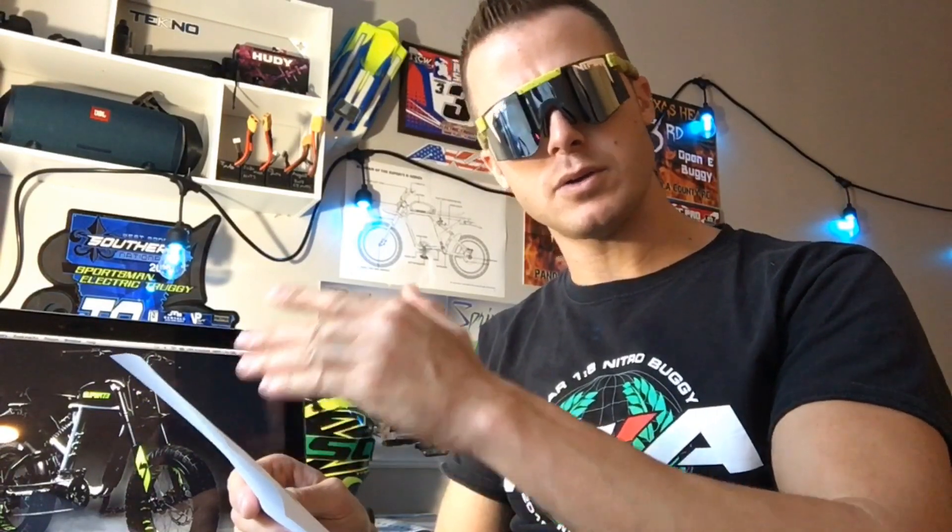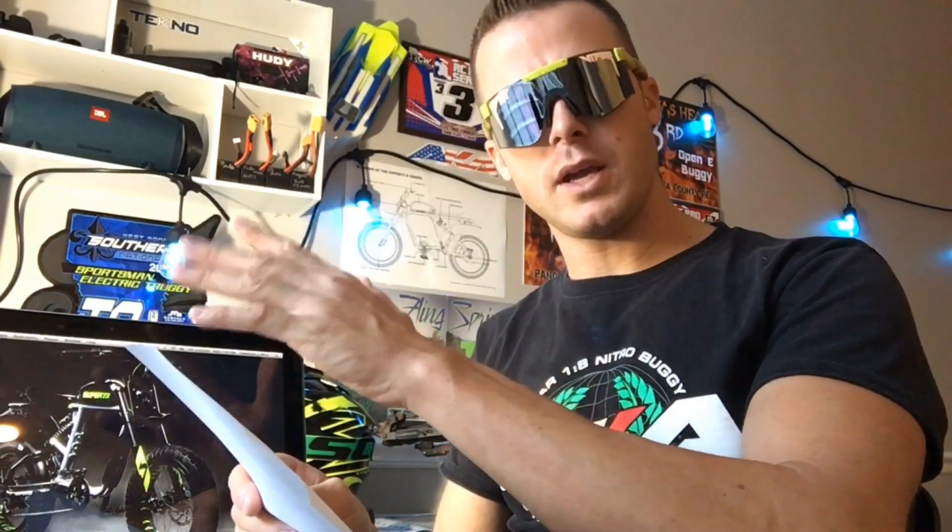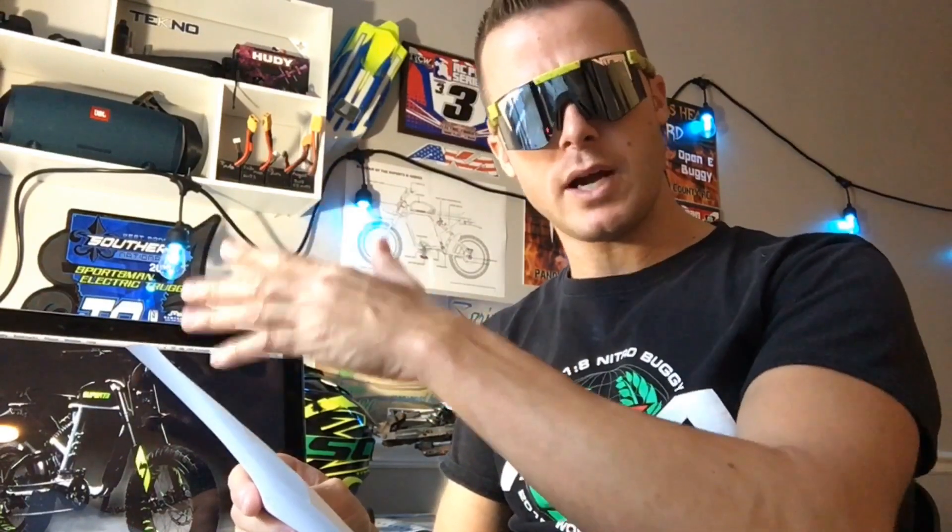I would go to about 28, 29, or 30 PSI — keep it in the high end of that range. That'll eliminate any issue where if you hit a bump, your tube gets pinched. Just keep your PSI between 27 and 30 and you'll be good.